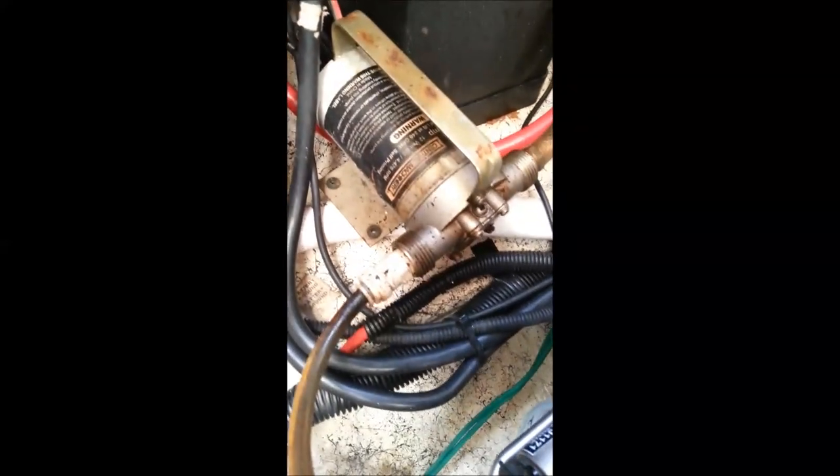I have a little pump here. It's a little 12 volt — I think they call it a water pump. It's from Harbor Freight. Just hook a couple of hoses up: one is a discharge to an empty container, and the other is a siphon or suction that I hook right to the dipstick tube.